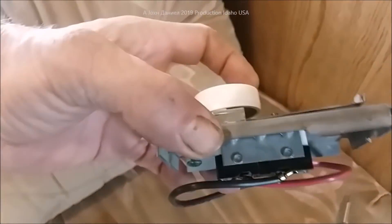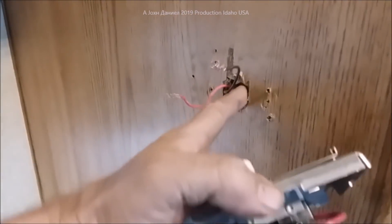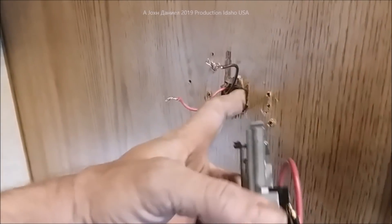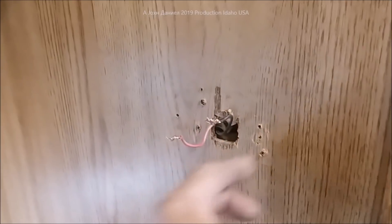We're going to do the same thing here when we mount this, because I don't want cold coming from inside this refrigerator cabinet — there's a refrigerator right there. In an RV there's not much inside the wall, and you can almost feel a little cool air from the refrigerator cavity, which is open to the outdoors through a vent on top and a vent on the bottom letting air circulate. We don't want that cold affecting the thermostat, so we're going to insulate it.